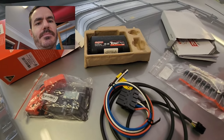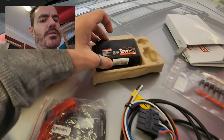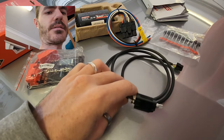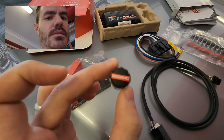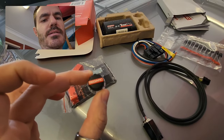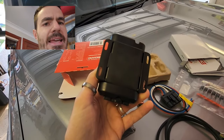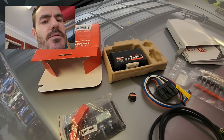With the basic kit you get when you buy the controller you basically just get the main control unit and this little wiring harness — there are only about four wires on it so it's pretty simple to wire up. This other little unit is basically the dial; all you really see on the dash is this tiny dial here, very clean and concealed, not like the old ones with big units hanging under the dash. This unit has to be fixed solidly because the accelerometer needs to be fixed solidly to the car to work properly.